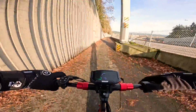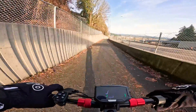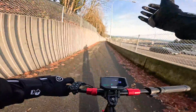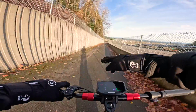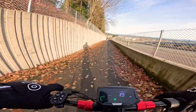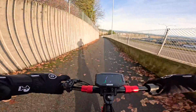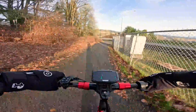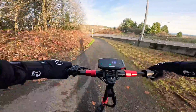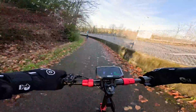So like I said, the scooter goes 28 miles per hour, but that's in the fastest mode, of course. We also have speed mode 1, which goes up to like 10 miles per hour. Speed mode 2 goes to 18 miles per hour, and speed mode 3, which is turbo mode, goes 28 miles per hour. And given that this is only a 48-volt system with a 15-amp-hour battery, they are really pushing it there. I gotta say, this thing probably blows through the battery pretty quickly at speeds above 25, or even 20, because we do just have a single 800-watt rear hub motor still.